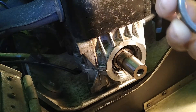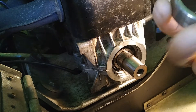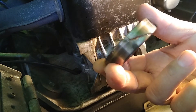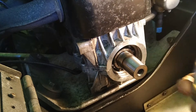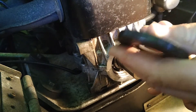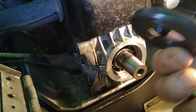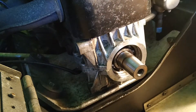We're going to use an old bearing — the outer race from that video I showed you before when I cut through it and popped it off. We're going to use that to tap on instead of tapping on the seal itself. You can see the seal has more depth than the recess, so we just want to tap it in flush with the outside of the crankcase.